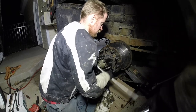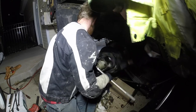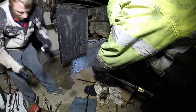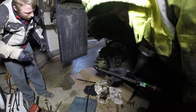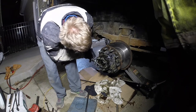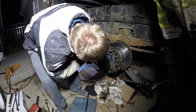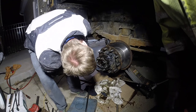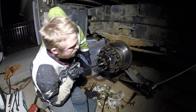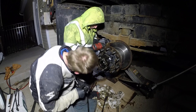Let's check how it spins — that spins real good. After you get final torque on the lock nut, go ahead and bend these tabs back. For this smaller axle, Matt was having a pretty difficult time getting those tabs bent back — it doesn't help that it was 14 degrees out and 1 a.m. at this point, but we were doing everything we could to make this repair happen.